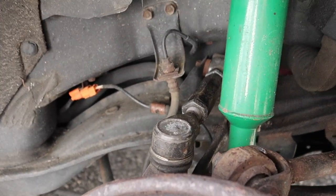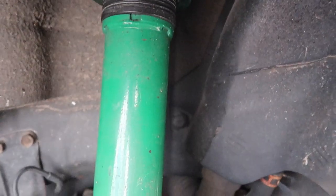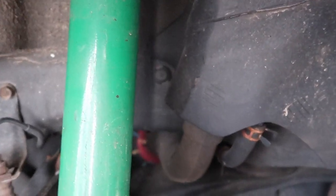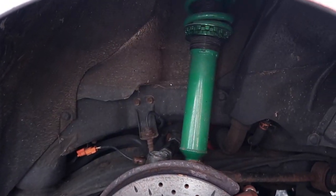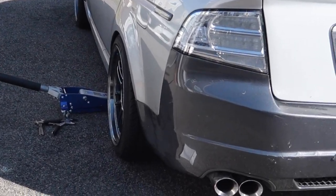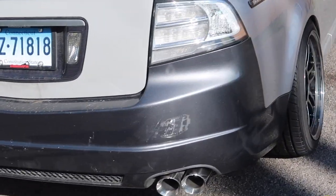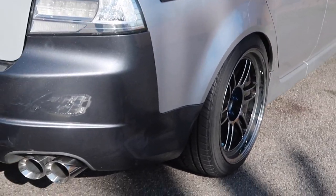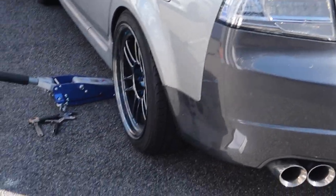I had about a half inch of travel right here on the other side for the camber kit, and right here you can see I still have just under an inch left to go lower. I did measure the other side and applied it to this side. Now I'm going to put the wheel on and see how it looks. I'd say that's pretty close — and I am sitting on uneven pavement — but pretty damn close. Everything's locked up. Now I'm about to torque this side down and then move on to the Skunk2 camber arms.